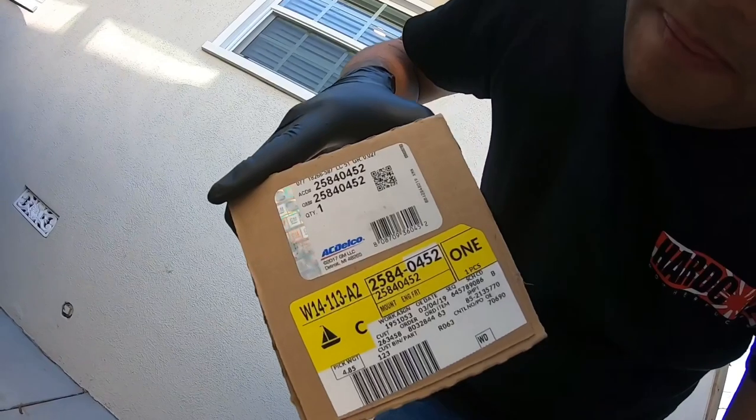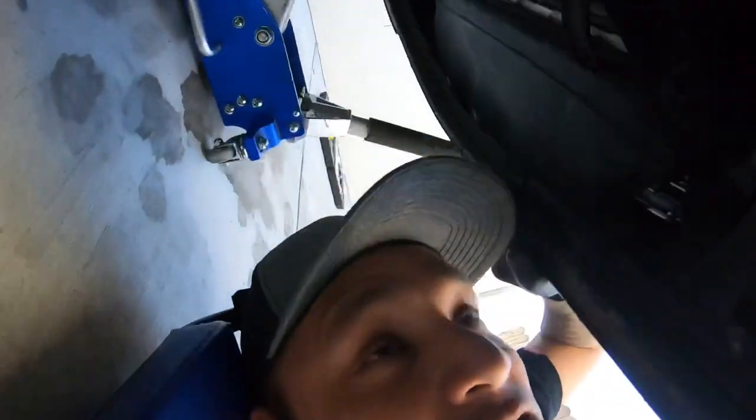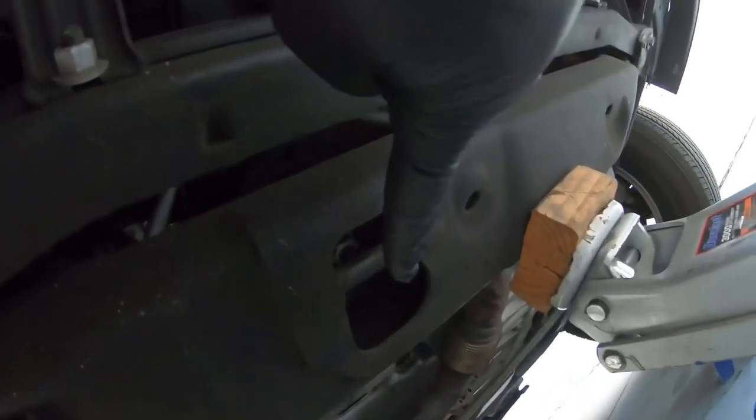We've got the front engine mount - AC Delco - and the rear engine mount. I'll put the part numbers in the description below when I'm done. Their positions are pretty straightforward, easy to find. Going into the car here on the passenger side - or right side if you're overseas - this is the bottom of the front motor mount. The rear motor mount is just back there. There's an access hole and we'll be figuring out how to get the top bolt off. This front one you can reach from the top of the engine bay, located right below the oil filter.